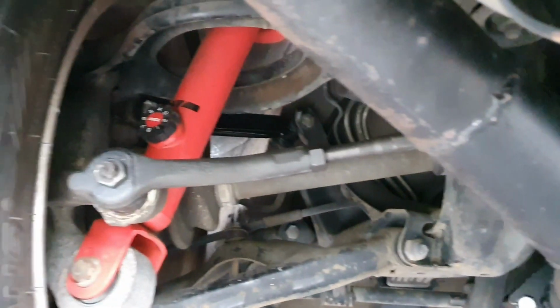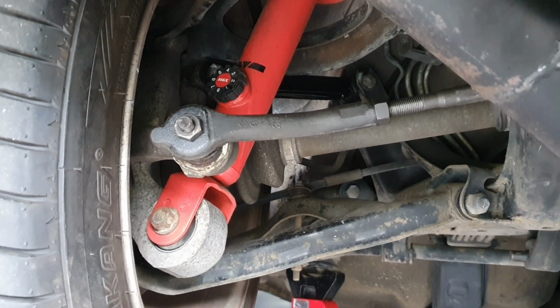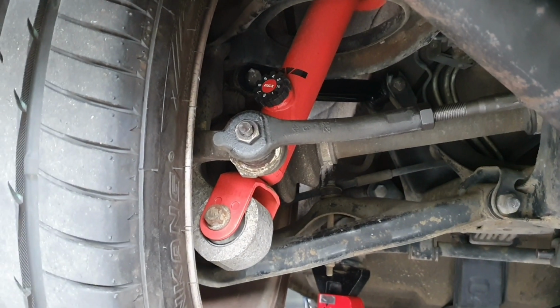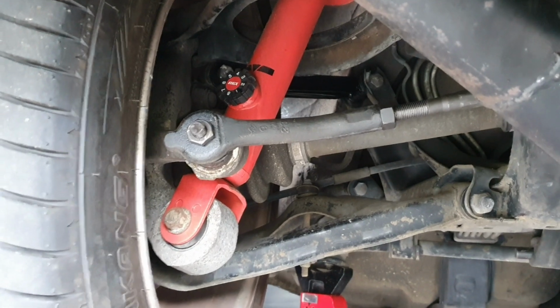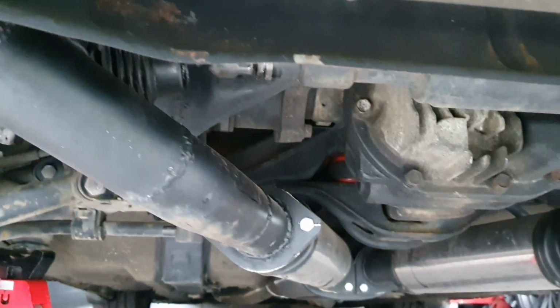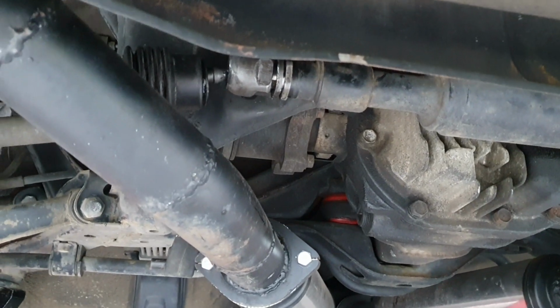So they have a ball joint in the knuckle, and typically the steering rod end, I'm going to call it, this big cast piece that you can see here, seizes onto that ball joint quite well, and it's virtually impossible to get that off without putting stress on the ball joint, which then stretches that and flogs that out. So that's cool. That was loose beforehand, I checked it. Remember in the previous video I did discuss that normally the ball joints are gone. Rack ends were gone, so that one's changed.